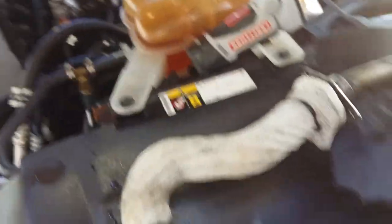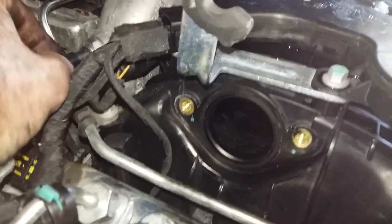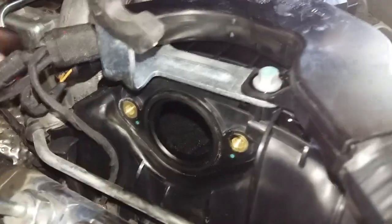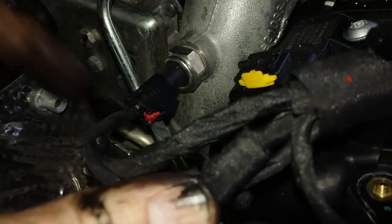In the meantime, until I get the EGR deleted, these big heavy foam pieces need to stay on because this tube has to stay hot and those gases have to stay hot. I've got the water injection nozzle right there and my progressive controller is coming — it's going to hook up to my Banks Bullet right here at the pressure sensor on the elbow out of the turbo, piggybacking off the Banks Bullet. When you're installing the Banks Bullet you unplug the yellow connector — that's your fuel rail pressure sensor — and then there's your manifold absolute pressure sensor; unplug that and your little connectors go right in there.